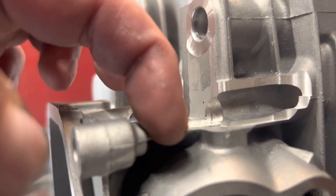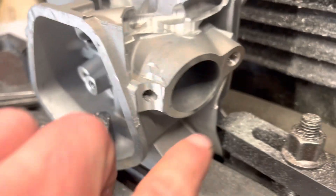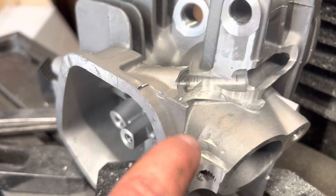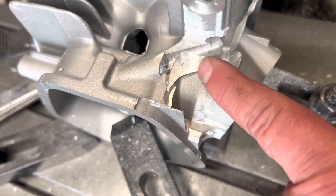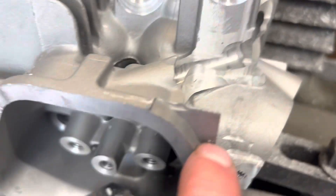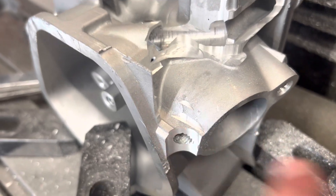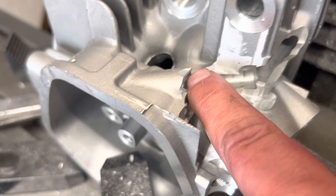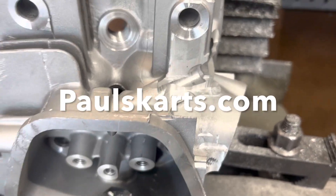I'm going to mill this off here and fill this whole thing with weld. I took down some of this because the tube is actually going to be angled, so it's going to come up here — this is all going to get filled with weld. There was a screw boss here, so I cut that off to get in here with the weld. I'm going to remove this part with a grinder since there's too much of a curve to cut on a mill. We'll fill all in down here with the weld, build this all up, and the tube is going to be offset and at an angle up here. We're going to get max flow on this head — a lot of work.